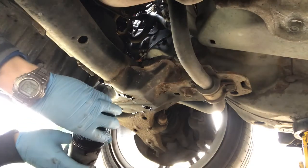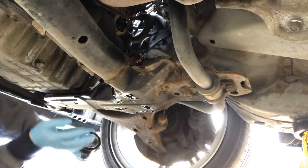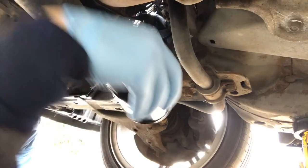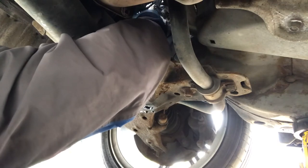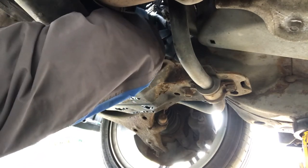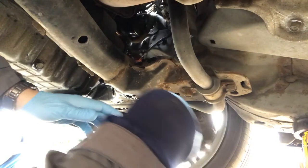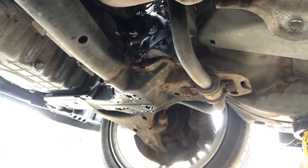I'll just give those a little rub so it's nicely oiled around the seal. Right, so the new filter, we've oiled it around. And then we'll go back in the same way. Back up there. And whiz it up on that thread. So with these, it's always hand tight, and then a quarter of a turn just to nip them up with the tool. If you're using a claw type wrench, be careful not to crush the filter.